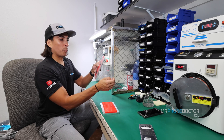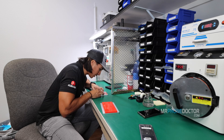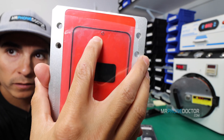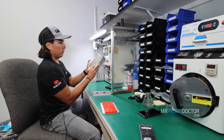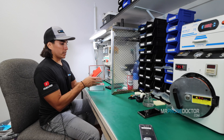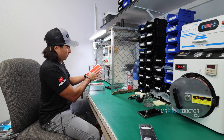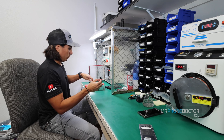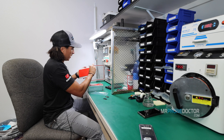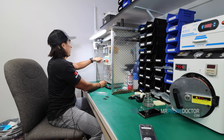Once we have that laid down, we can go ahead and use these little black stickers here, which attach the OCA onto it. It's very simple. All you have to do is align this camera punch out with this punch out here. We'll set this in here, make sure everything's aligned properly. Once it's aligned, we can just press down on the sticky and that's pretty much it. You can see how it's nicely aligned with the camera punch. Once we have that, we're going to use our regular laminating mold. Set this on, and we're going to use this rubber one to grab the OCA, then press down, lift up, and we have a nice OCA fit. Work out any bubbles that may show up. We'll go ahead and remove these black grommets and remove the first layer from the glass to reveal the OCA adhesive. Set this in our laminating machine and let's go ahead and laminate.